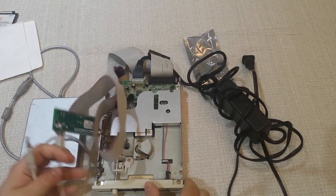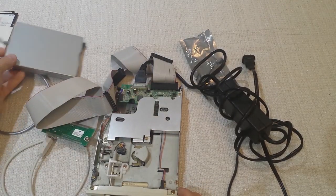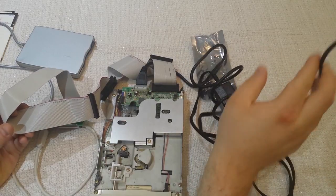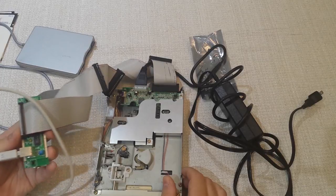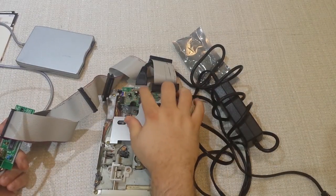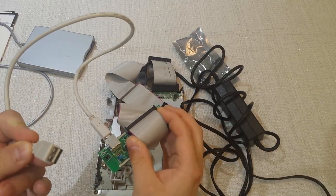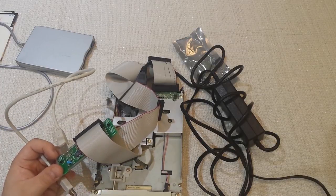Device-Side Data used to make an enclosure that you could put this thing and all the other pieces into, which would basically be self-contained just like the three-and-a-half inch USB version. Unfortunately, that's been out of stock since about 2014 when I actually bought this, and they're still saying it's going to be back in stock soon. In the meantime, you can get your own external enclosure, but I chose to just use it like this. I was surprised it didn't break — they always told you static electricity would fry these exposed boards — but so far so good. The setup is: power goes into the wall, connects to the floppy drive, then the floppy cable connects to the controller, and the USB cable comes out and goes into your computer.